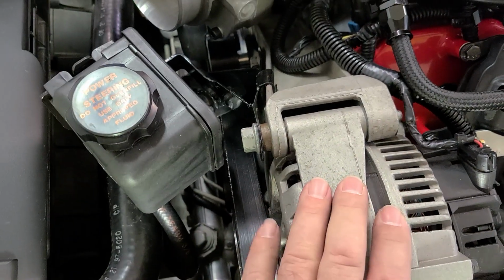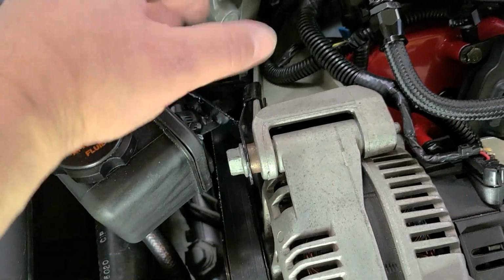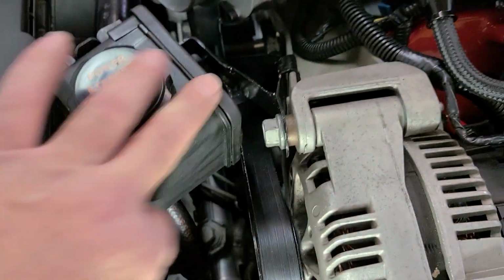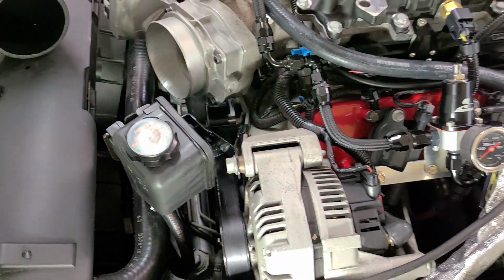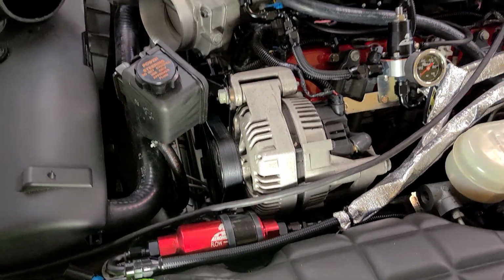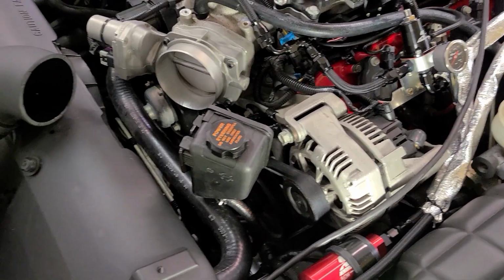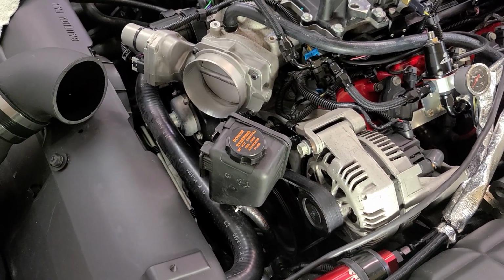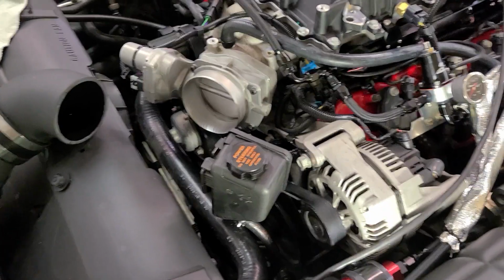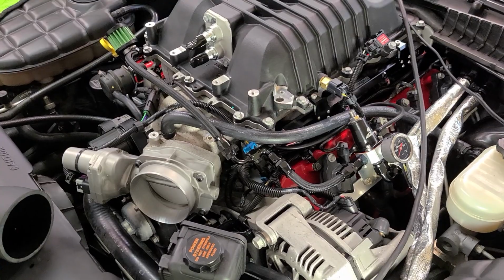And if I've got to do some alternator work, I'll back this out, cut the head off, lift the bracket up a little bit, pull the remaining piece of bolt out, and then go back together with a stud and a nut, and I think it'll be just fine. But ready to pour some oil back in it and put the intake back together, and then it's on to pinning the crank.